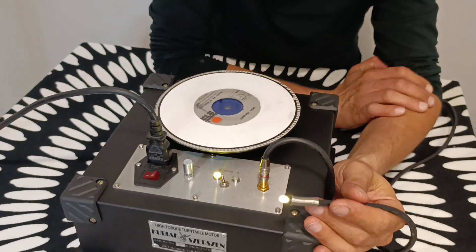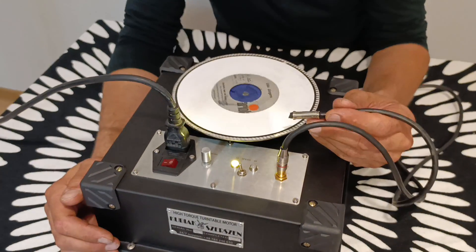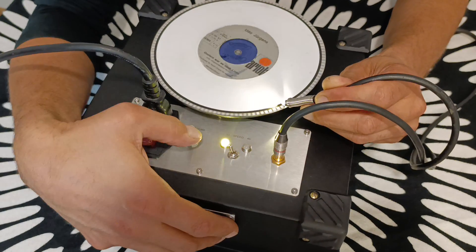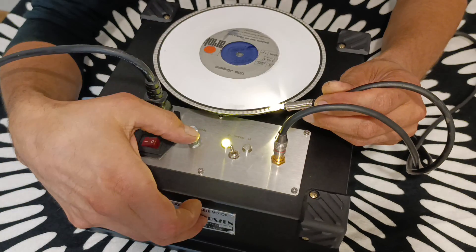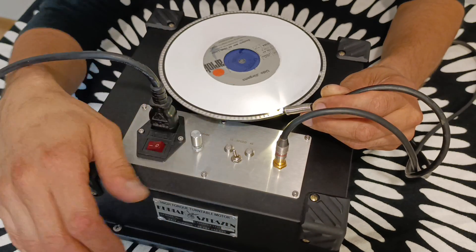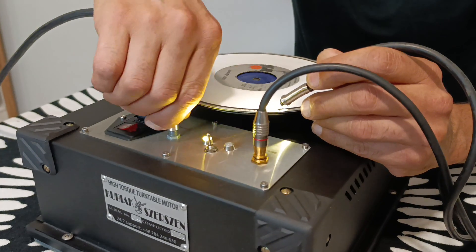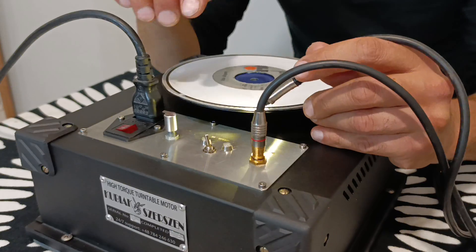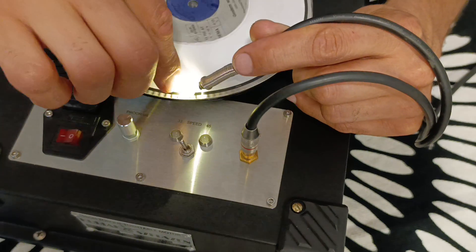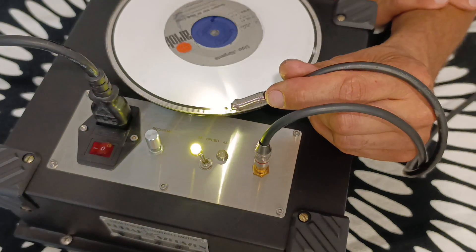You may plug any 3V LED light into it — just get any wire and any LED diode, so it will perform fine. It's 33 ballpark. I'm going to reprogram it to 45. I'm going to push the knob on the 33 mode, push this knob for like 5 seconds. By turning clockwise the speed increases. Once I'm sure that I'm having the perfect 45 RPM, I have to push the knob quickly once again. The light stops blinking, stays still, and it means that the speed is encoded.